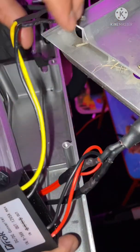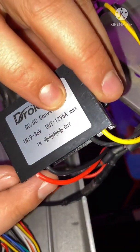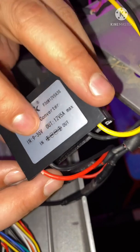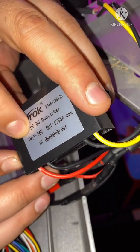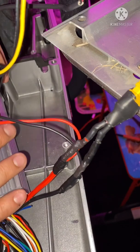For the output, you've got your black and yellow wire - that's going to your tail light at 12 volts. That's going to your tail light. The input, which is 36 volts, is gonna wire directly to your battery pack.